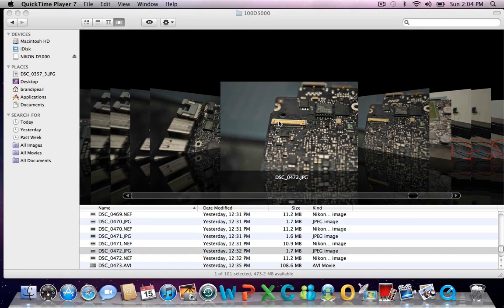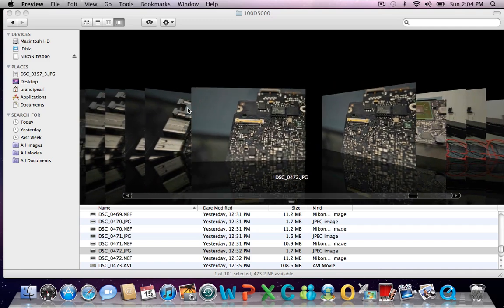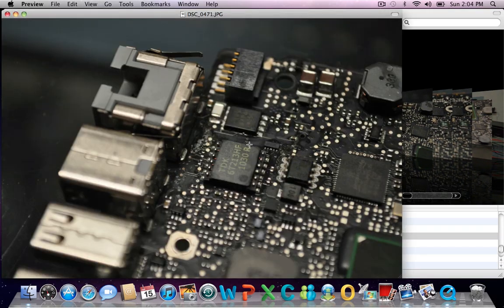With the pictures we have right here, this seems to be a coke damage spill that turned into a corrosion issue in these later pictures. You have it where it flowed like that. Now, in a unibody, you're talking about a system where the board is only probably eight inches. So the travel distance for the corrosion is pretty significant. From the top side to the back side, it's very feasible that the liquid ran and settled on the underside of the board and caused damage to the system.